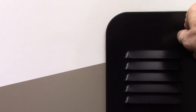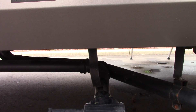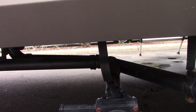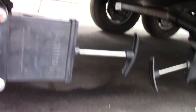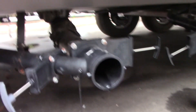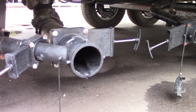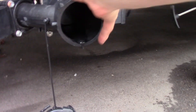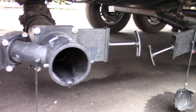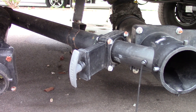The other switches are inside the trailer. Here are all your dump valves. You've got two gray tanks — this one here and this one there — and your bathroom hookup. There's your black tank valve and your gray tank valve. The black tank is toilet water and waste; the gray tanks are sink and shower water. You'll dump your black tank first, and after it dumps you'll dump the gray tank because it's cleaner water and it'll wash out the line.